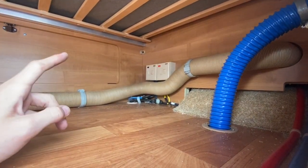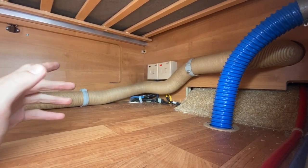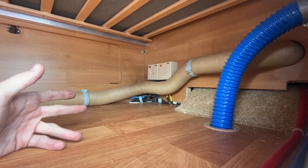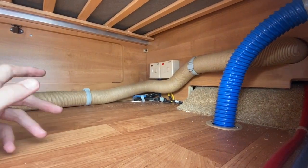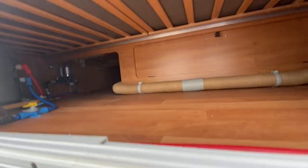With your Ultra Store, if there's no water on board, turn it off if you are hooked up. Otherwise, it is like a kettle. It will just fry the pump and the element out. And then you do also have a good bit of storage underneath there.